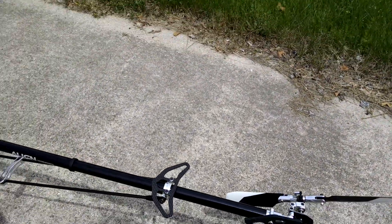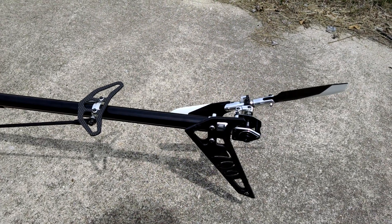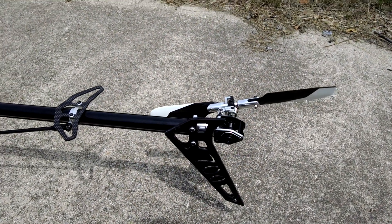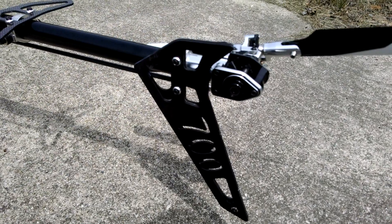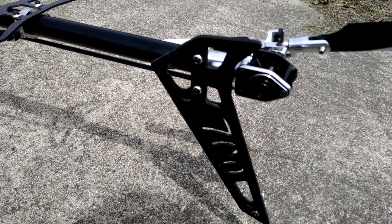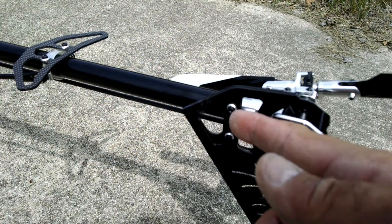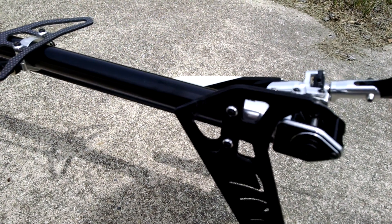What I did find was — and I'm not telling you guys to try this, because it's crazy — I put it in a hover right in front of me, about two feet away, and I could see that tail fin start vibrating like crazy. When it starts vibrating like crazy at the bottom, it just travels all the way up, and in return it gives that torque tube a torsional vibration that'll drive your torque tube back in.